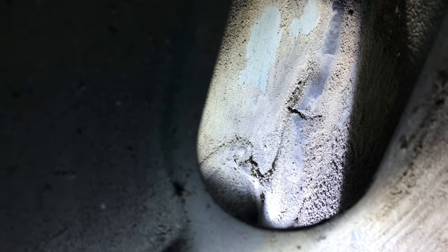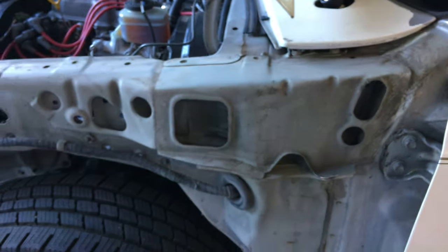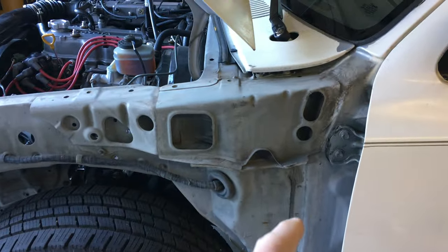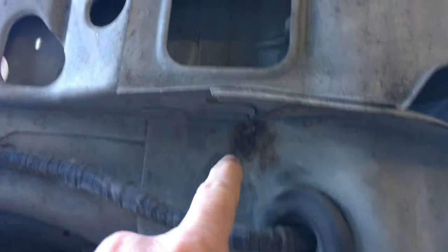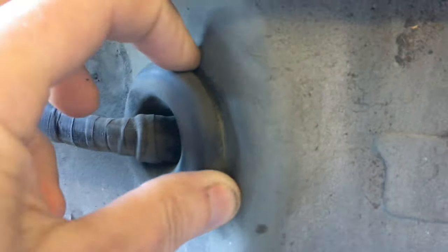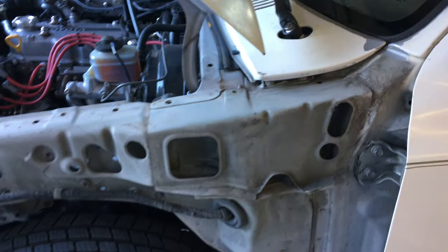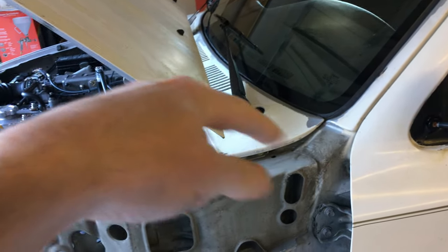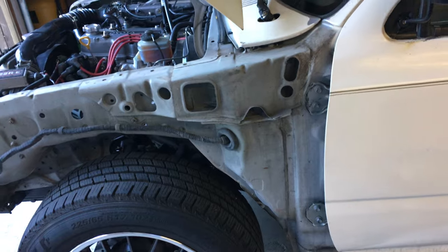What I'm going to do — and there's a drainage hole right above that from what I can see — is clean up the dust and put some ultra black RTV sealant on some of these areas to just get a watertight seal. I don't see any problem around this grommet, and I'll see if that will put a stop to the little dripping that is getting into the truck.